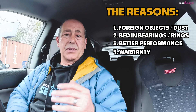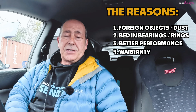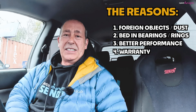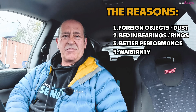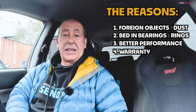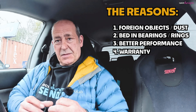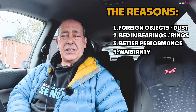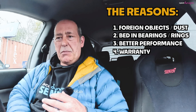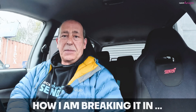Based on my experience with these engines over the course of the last 23 years — why don't I just send it straight out of the box? It's really tempting; a brand-new engine should be really nice and strong. But things need breaking in: the piston rings need to be pushed out to the bores to help seal the engine and get much better compression and much better power performance.